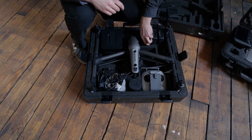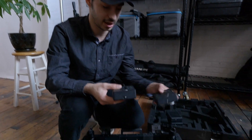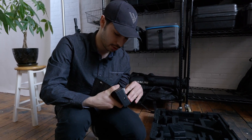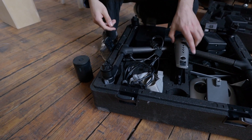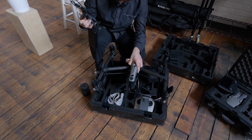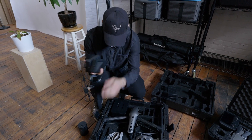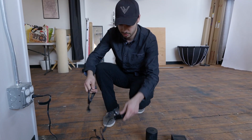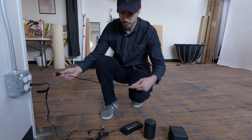The battery insulators help immensely when you're flying in the cold. Another thing with the Inspire: you have to make sure you're pairing your batteries so they're in the same charge cycle. We have both batteries labeled 'A' so they get flown together — you can't intermingle them. You can see to charge the Inspire is kind of a process. With the Inspire, you have a set of batteries, where the Mavic only takes one little battery.